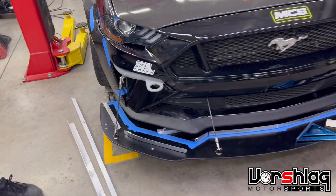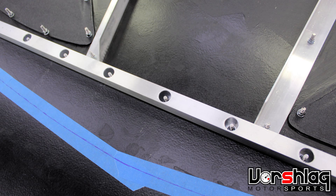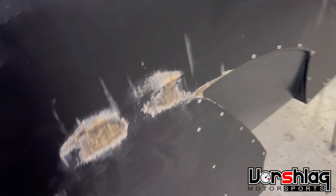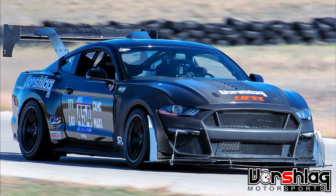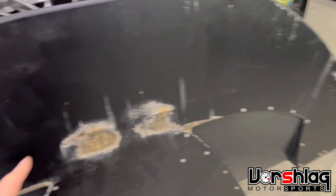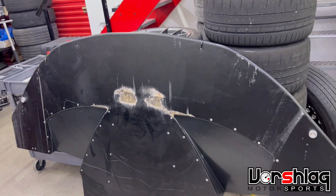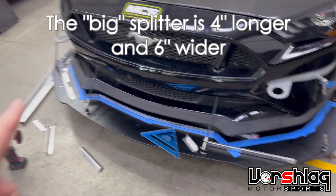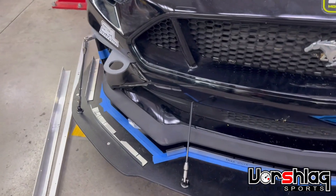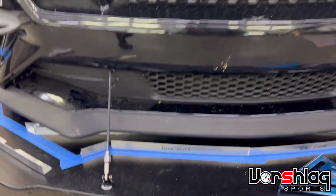And we already have a piece of that one inch tubing that you've snuck inside laterally — it's about five feet wide. That should give us some strength here. We had a little bit of bowing, and the bowing we're seeing along this plane is causing it to touch the ground at high speeds, about 130. It was scraping a little bit, so we're having to beef that up with some bracing on the top side. This is the small splitter and we get to do it all again for the big splitter we use for NASA. We'll have some gaps in it because there's going to be race roll plastic, so we're just trying to hold the race roll and have it touch the lower part to bridge this two-and-a-half inch gap.